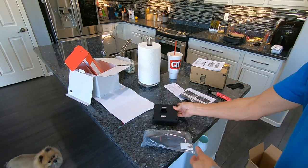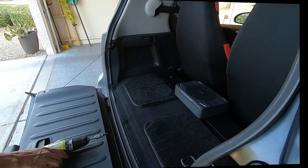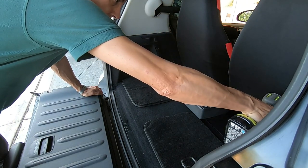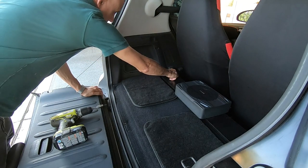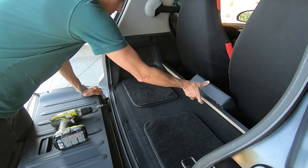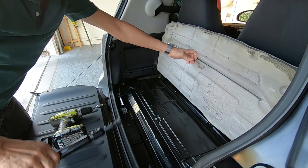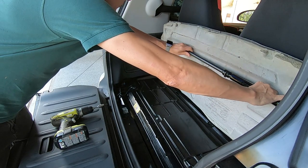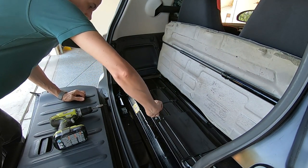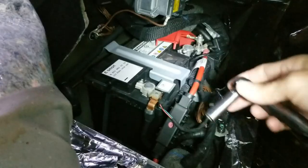Let's get started. In my car I have this subwoofer I have to remove — you can see that in another one of my videos. Let me just raise up the rear carpet. I use this hood prop stick to hold the carpet up, it comes in handy. Take a quarter turn and pop this cover off. Step one: disconnect the battery.